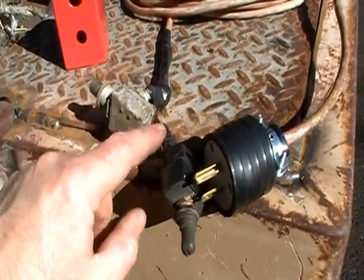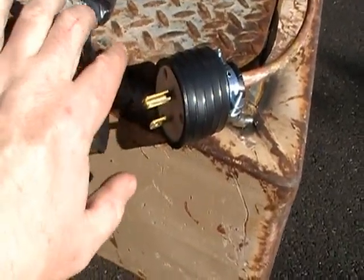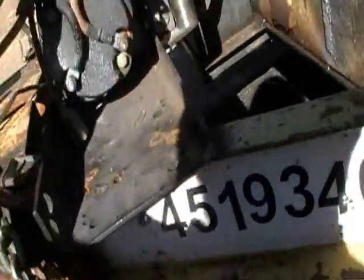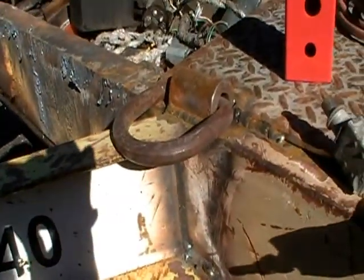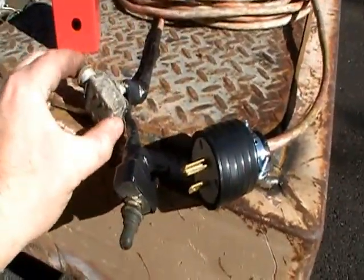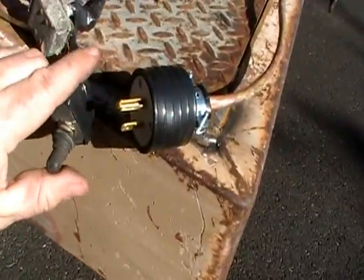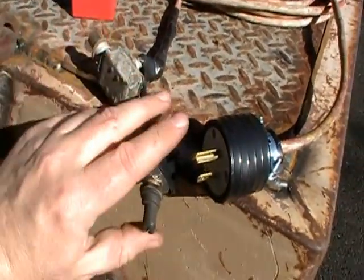Run your power through here first, then run a wire up to this switch in the center, and then two wires back to these two terminals. That'll give you in and out. And this way you have a safety — so you hit the button and nothing happens. It's not until you click it one way or the other and hit the button that the winch will actually move.